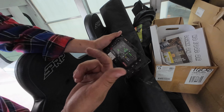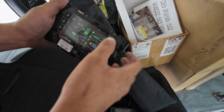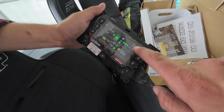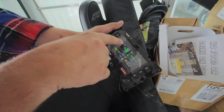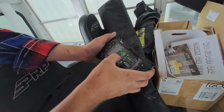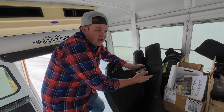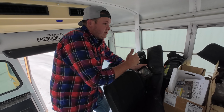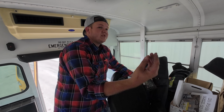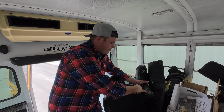Oh, look at this. Battery's at 100%. We're pulling 22.6 volts off of the sun. We're not charging off the vehicle, and we're not plugged in. So it's going straight from the solar panels. Yep, we're 100% charged right now, and it's pulling 22.7 volts from the panels on the top. Pulling 5.7 amps. It's a pretty sweet system, actually. So the way this Redarc system works is if you're driving down the road, the alternator, we put a 250 amp alternator on it, so it'll actually help charge it, and it'll slow down the charge from the panels. Or you can be stationary and plug it in.